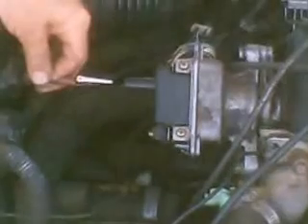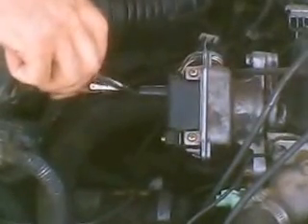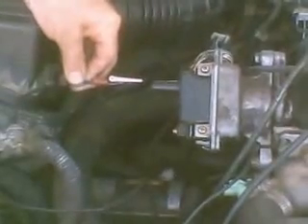Take the cap off and get yourself a wire with two alligator clips on it. Ground one end, and hold this clip close to the spring that comes out of the coil tower — don't touch any metal part. Have a helper crank the engine a few seconds. If your distributor is working, a highly visible spark will jump to the ground — a continuous stream of sparks, not just one, as long as the person is cranking the engine.